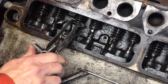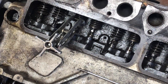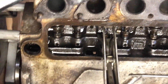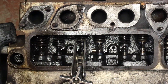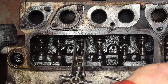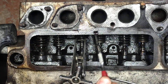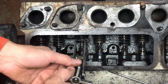Tighten that. Now the valve wants to come off when you tighten it — that's fine. I have a soft blow hammer here and I'm going to just tap the top of the valve, that releases the locks — valve keepers, also known as. One landed over here. One still on there. There it is — two halves, valve keeper locks. I keep a little magnetic tray over on the side of my block there so I can store them.